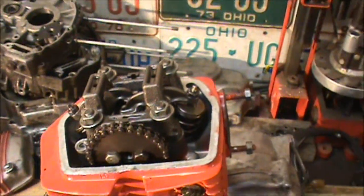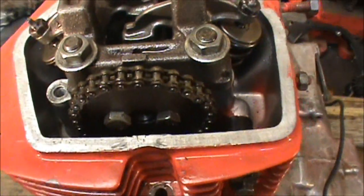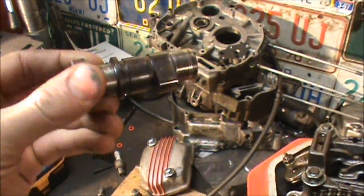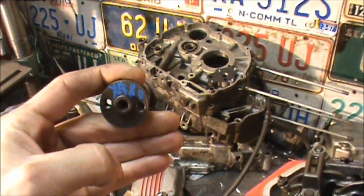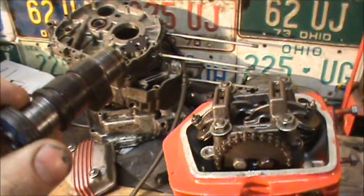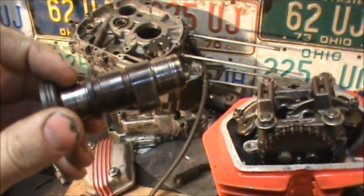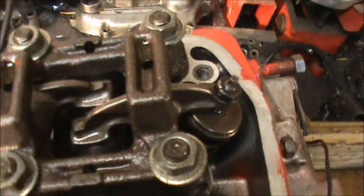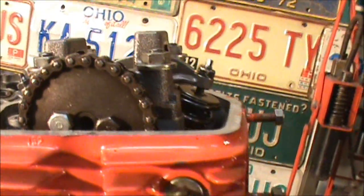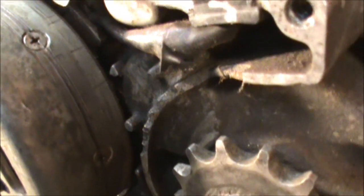So now to set the timing, if you look down in here you have your camshaft, which your timing chain sprocket is attached to. I've got one right here to let you see it a little better. When you're setting your timing, it's very important to have these two cam lobes pointed down at top dead center. Right now they're pointed down, that timing mark's lined up pretty good, and this line is set up right here.